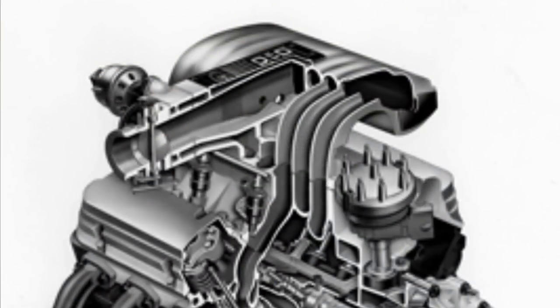Speaking about the intake manifolds, there's a really interesting tidbit that should start this off. To understand the manifold we find on our 5L fuel-injected cars — they are quite different. They are a huge departure from any of the previous carburetor or throttle body injection designs because they have these super long intake runners, and that's because it is a dry manifold design. That means fuel does not have to flow through it, so you don't have to worry about puddling. This allows engineers to explore really long runner and interesting complex designs which can promote a lot of good low-down torque, which is inherently street ability and off-the-line punch.